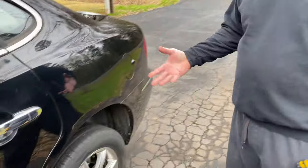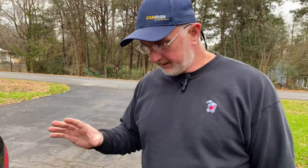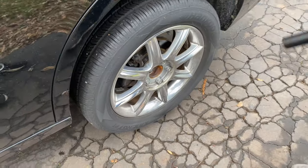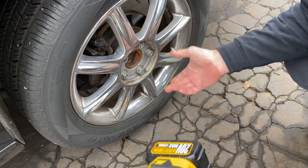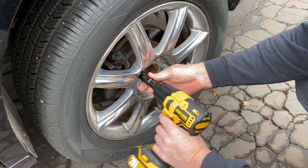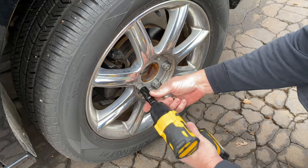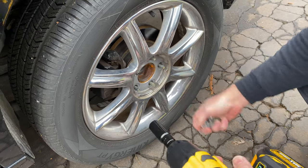We're out here by our Buick — got it up on jack stands and we're getting ready to do a tire rotation. Just a safety note: if you are doing your own tire rotation at home, make sure you use the proper equipment — use a jack and jack stands. Do not ever crawl underneath the vehicle unless it is properly supported with jack stands. We've got it set on the highest setting. These lug nuts are probably torqued 80 or 90 foot-pounds. Let's try it. Pulled it off with no problem — that did not even struggle one bit.